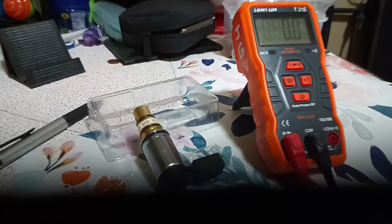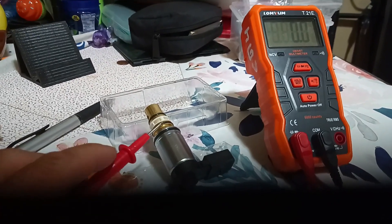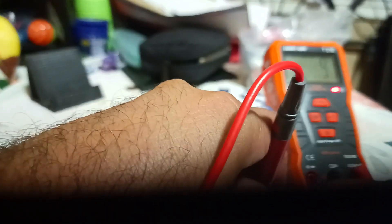I want to do a little testing with my new AC compressor solenoid to show you what you have on here. Let me test the leads and see what we get, so I know what I'm looking for. I'm going to touch both pins — this is a two-pin connector. Touching correctly here, there is continuity and I have nine ohms.